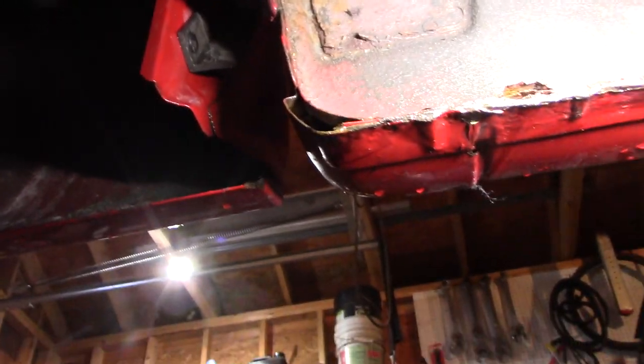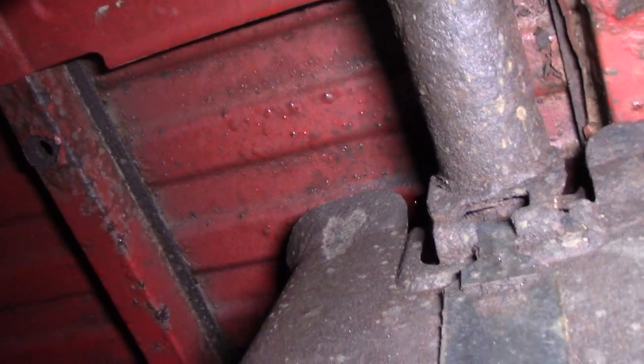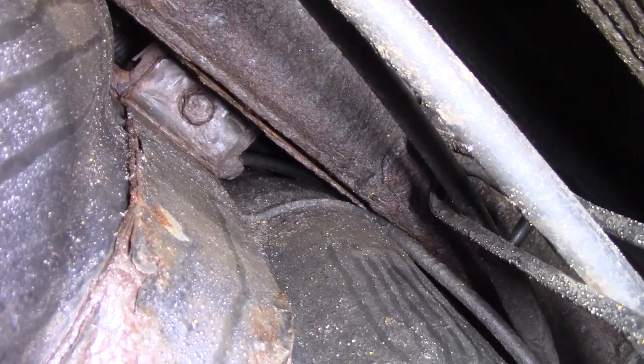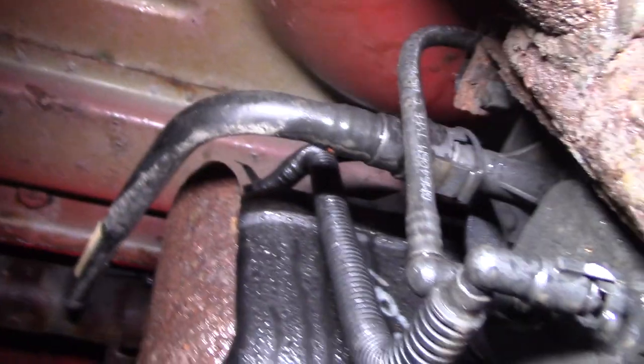So that's a cab corner — this vintage truck, those would be missing. This actually has a great body. The reason I'm telling you that is because underneath this, the frame and everything else is pretty much shot. Looking at the bolts for these straps — as soon as I put a socket on there and try to bust that off, it's going to break off clean. Trying to drop this tank with the evap, the charcoal canister and all this stuff is just going to break.